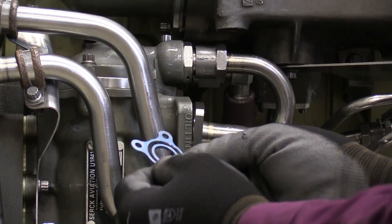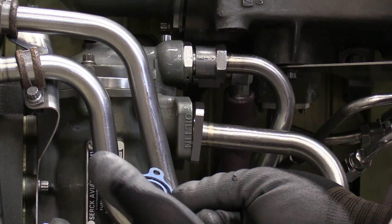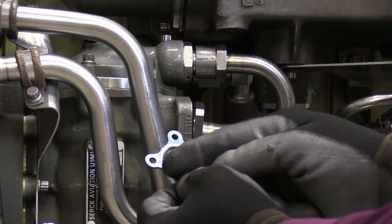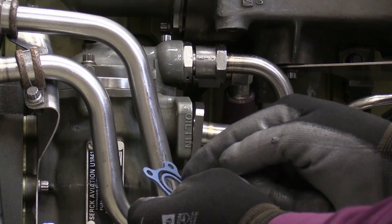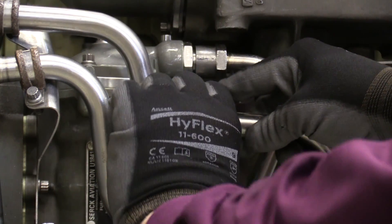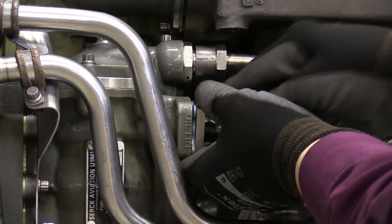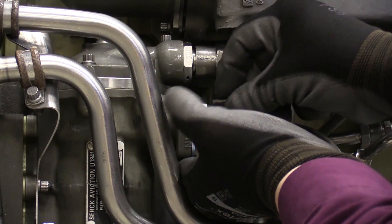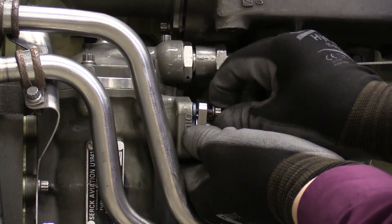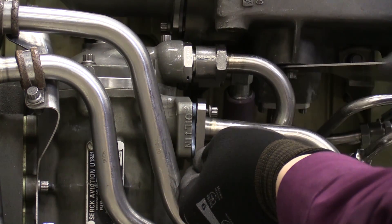So I've done my inspections per the Aircraft Maintenance Manual standard practices — if permitted, to reuse this gasket seal, or I've removed it and replaced it with a new one. Since this is an oil system gasket seal, I'm going to reapply Aircraft Maintenance Manual approved oil and slide it between the servo fuel heater and the manifold connection. Then I'll take my bolts, start to run them down by hand, run the rest down with a socket, and then properly torque them.